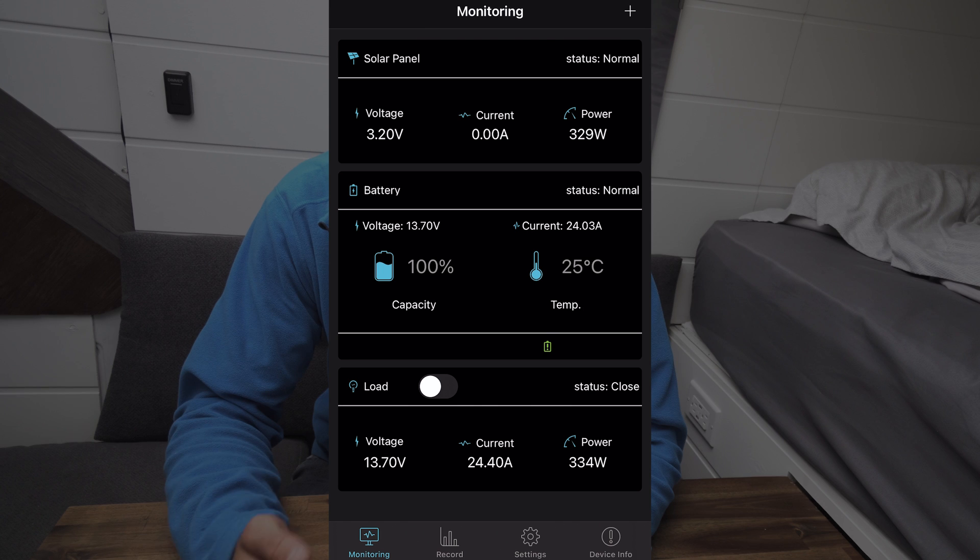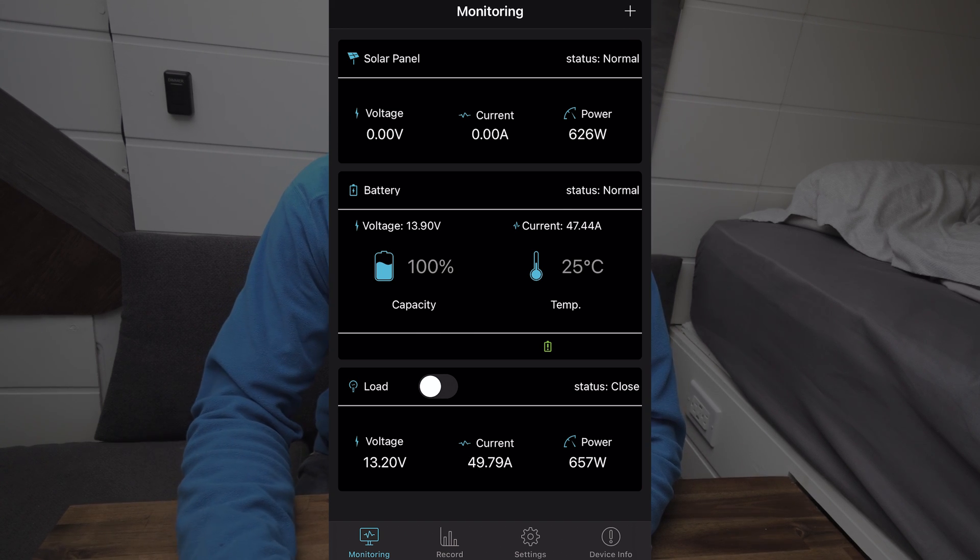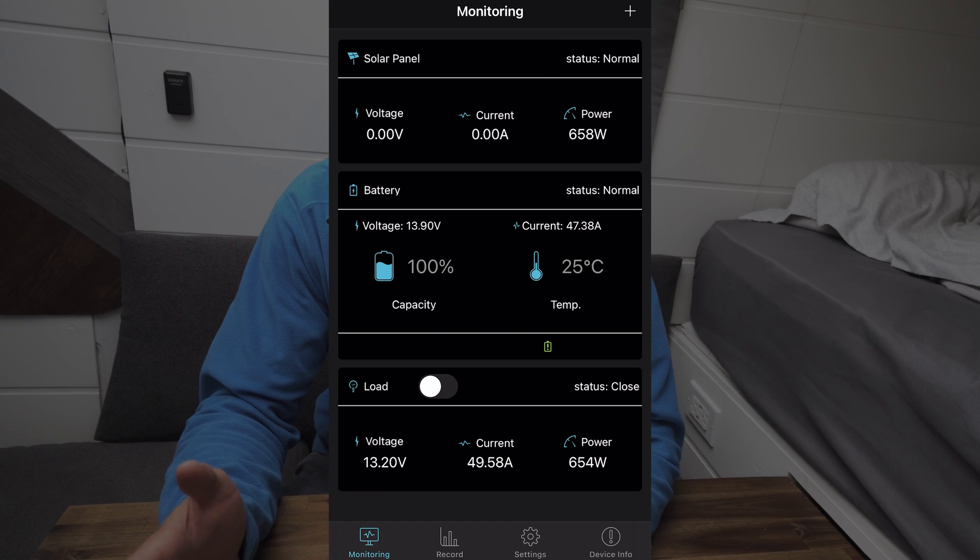I'm gonna go ahead and shut off that switch to cut off the solar panel — now we're getting zero volts and zero amps from solar, and the battery is charging at 47 amps. That is proof right there that this charger works really well, you just need to install a shutoff. So there you have it — I hope you guys enjoyed the video, good luck with the installation. It's a great controller, there's just that one flaw. Renogy might come out with new programming to solve that issue. Be sure to like and subscribe, check out the links below for the solar guide, and use the discount code 'made to travel' if you're purchasing anything from Renogy.